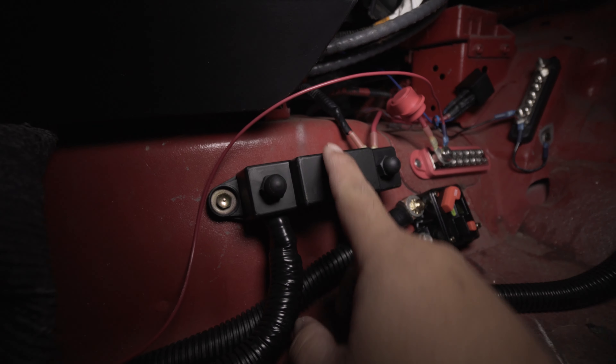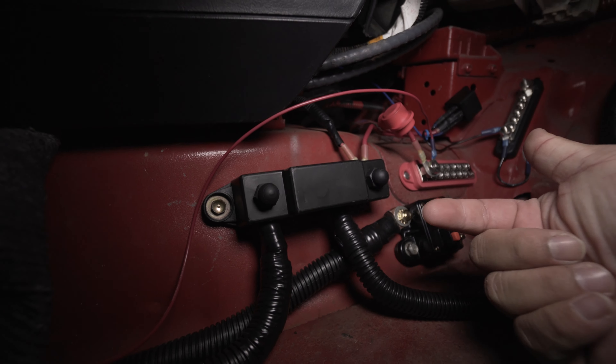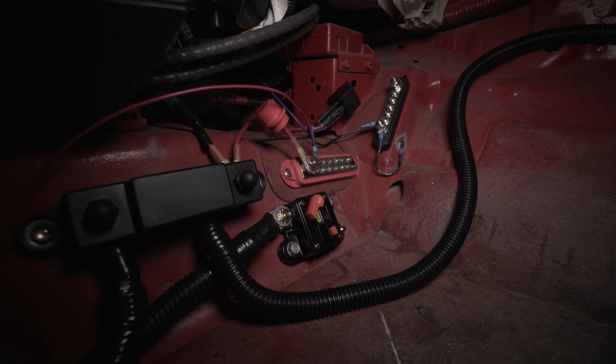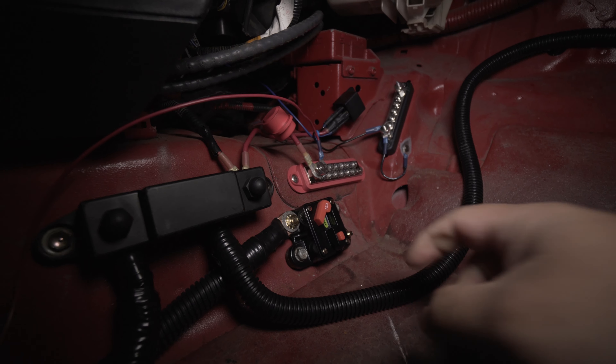My dual-side gauges and the dash - in a previous video the dash was acting weird, so I thought it might not be getting the right amount of power. I ran a dedicated power line to it and it's still doing the same thing, so there's definitely something wrong with the cluster itself. I think I really just need parts - I don't actually need a whole new cluster - but on the other side, here's what I've also been doing.